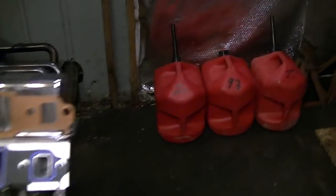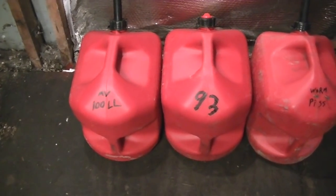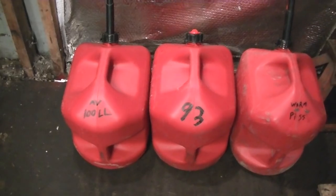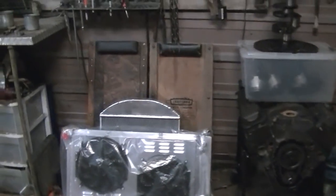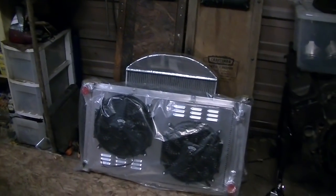I got some fuel for it. I ain't going to say what kind of fuel I'm running in this thing, but you can kind of look at them two cans on the left and take a wild guess. That'll be good enough for break-in — see what happens, see if it'll run off just 93 after it is broke in. But I need a little bit of lead to keep it from pinging, just to make sure. I don't know if I need it, but I just want to be sure.